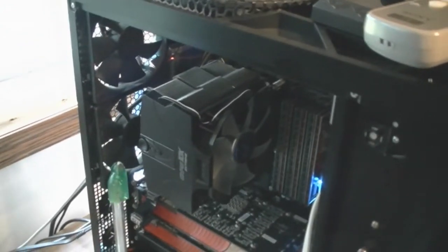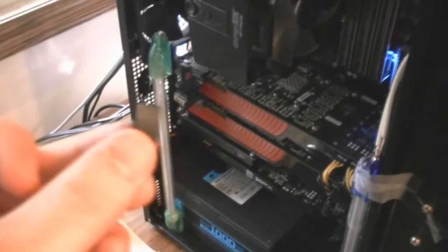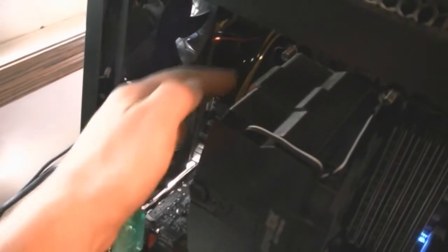Welcome back to another James D video. Just one quick thing about the Zalman — I've gotten people asking me what the hell do I do with that wire. On a heatsink with smarter wire management it would be back here so you could hide it behind the board tray and plug it into the four-pin over there, but this one comes bundled with this thing here. So what I had been doing was just keeping it tied tight together and having it hang around here, but that's kind of impeding airflow.